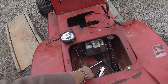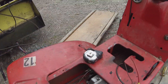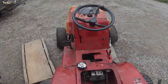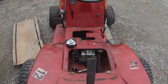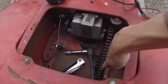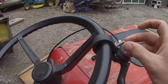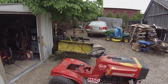But I made this too small for the other one, so now I'm going to make this two inches taller so that we're not pulling at such an angle. We'll maybe get some better stopping, because right now there's a bit of resistance but nothing to write home about. So we'll make that - I've got some of this that I bent up, make it a bit longer, drill the holes in it. And then we need to add a brace from the transmission down to the axle mount, and we will go from there.